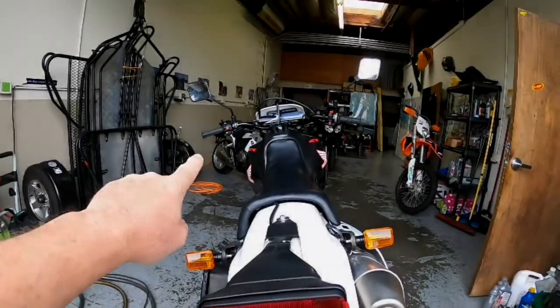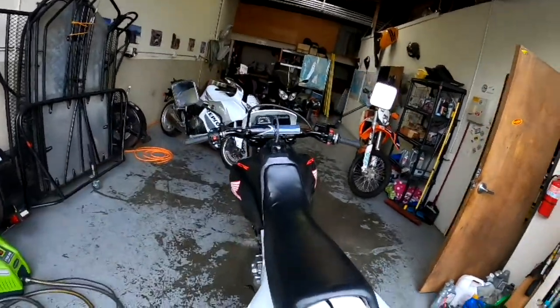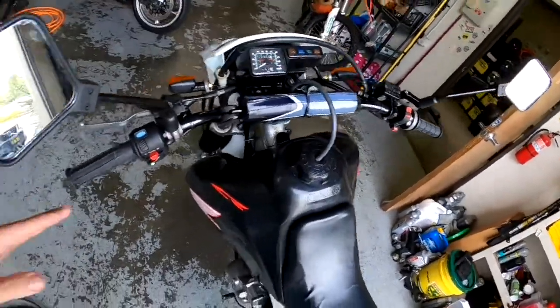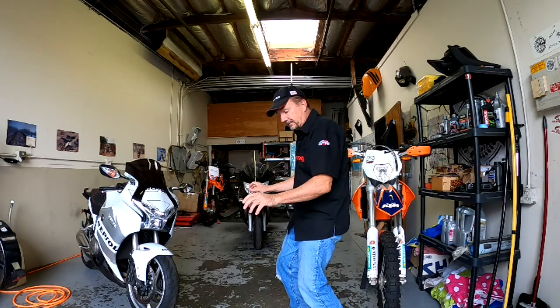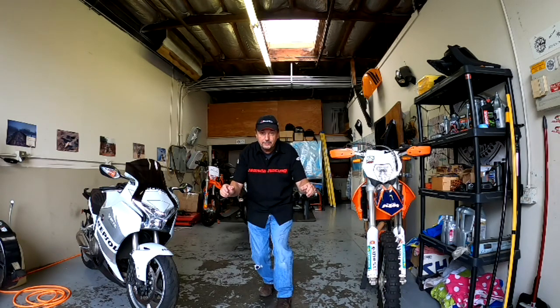If your bike has a look of sort of a dopey dog, you see how those bars go down on either side. And if we look from the top, they go in or back quite a bit at the front. If the bars are in like this, or pulled back, what does that do? That pulls my elbows in, right? If they're down, it even makes it worse. So I'm going to go down and pulled back. My elbows are in here, and that's not a very good position for off-road, right?